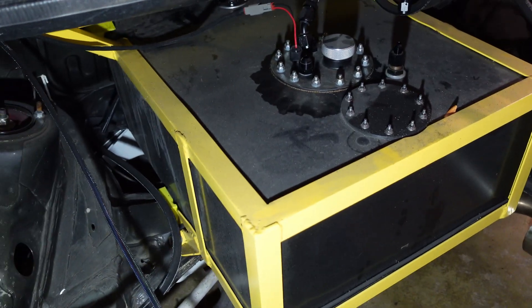I was on a downhill so all the remaining fuel was away from the pickup. My pickup is in the back because of drifting, so all the fuel sloshed to the front because I only had a little bit left. Luckily I was able to roll the car to a flat spot, get some fuel to the pickup, and drive home — but I had no idea I was out of gas. So today I'm gonna fix that.